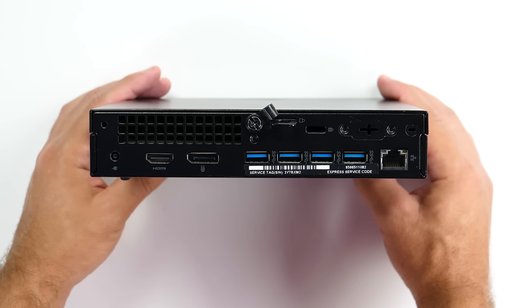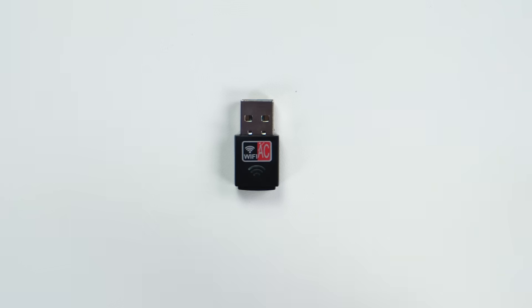There's also a chance you might end up with a PC that doesn't have Wi-Fi or Bluetooth. If that happens, I'd recommend picking up a cheap USB adapter online. You can wire it in through LAN to connect online, but you'll want Bluetooth for more controller options, so it's definitely worth getting.